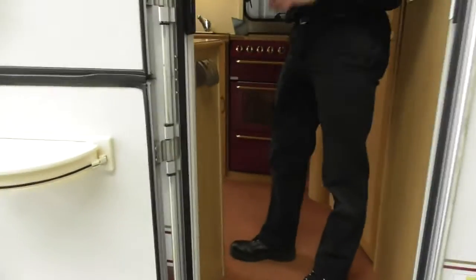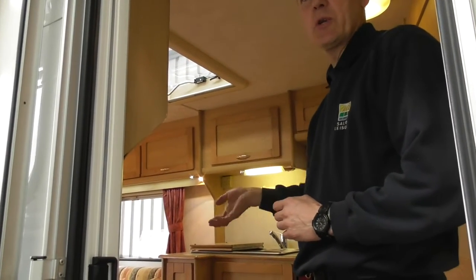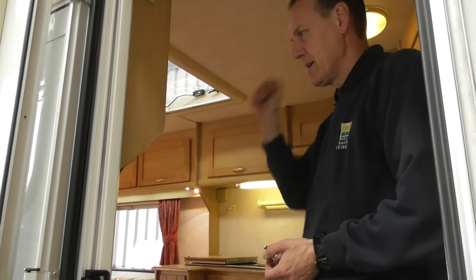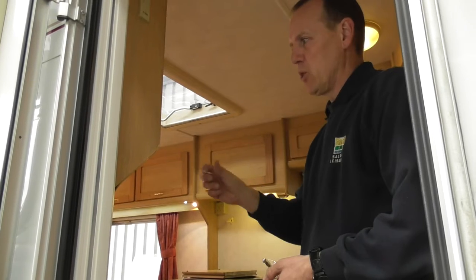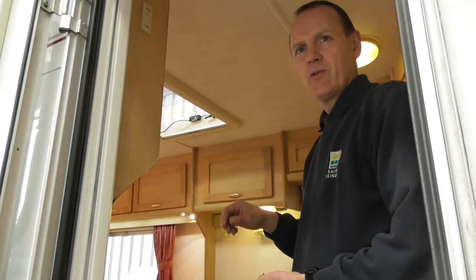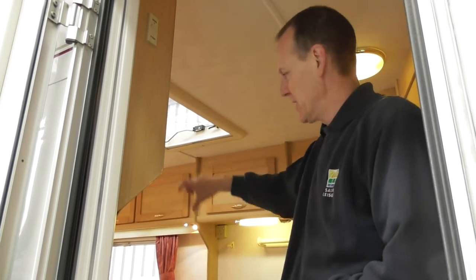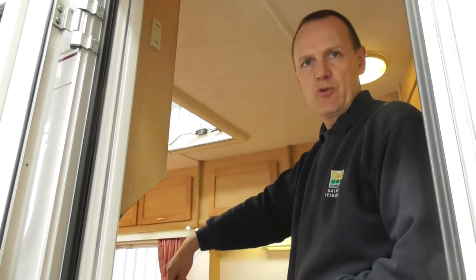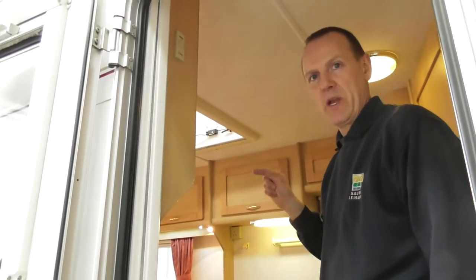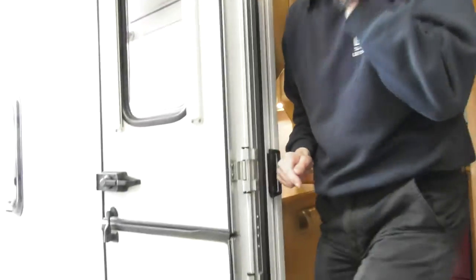When you're ready for going home, if you want to drain the boiler don't drain it straight away. Switch the power off — since you're normally off site before midday, flick your water heating off and give it half an hour or so to cool down before you drain it. Don't drain it on the pitch. What I tend to do is get to the gateway of the site, the wife opens the taps, and the movement as you're travelling helps drain the water out. It's obviously very important for winter that you do drain down — because water, caravan and pipes are not good.